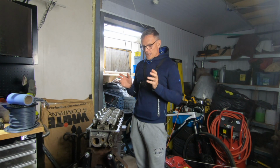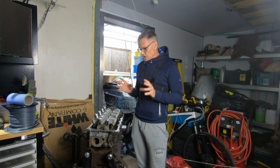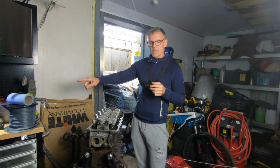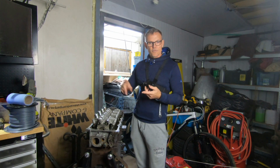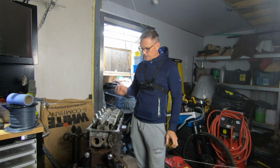So, as we last saw, this was the engine I'd picked up. We've been taking it apart. The issue I had was being able to get the harmonic balancer off, which we're hoping to fix up today, because what I have just over here is I bought the cam locking kit, it's actually for R53s, R56s, etc. So, I've actually already put this plate in place.